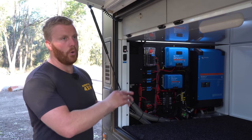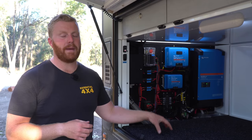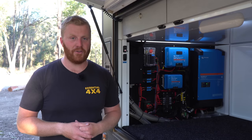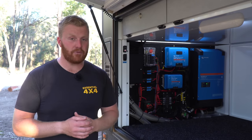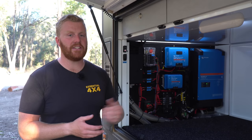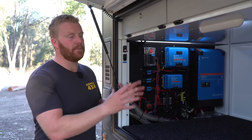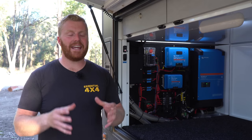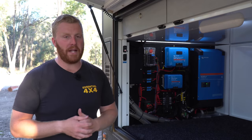What I'm trying to describe here is the fact that when you are plugged into shore power, you can be using any or all of the appliances on this camper and it's not going to be running through that battery system. There are two advantages for this: firstly, you're not reducing the longevity of these batteries by simply recharging and discharging them at the same time; and secondly, you could be using all of the appliances in this camper at the same time as pumping that full 120-amp charge back into your battery capacity.